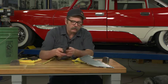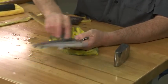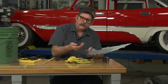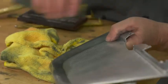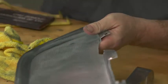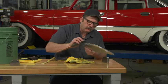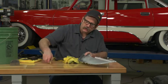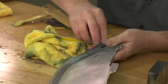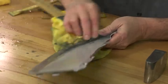Next we're going to move from 600 grit to 1200 grit. This will help refine the surface, make it a little easier to buff, and take out some of the sanding scratches left by the 600 grit. When you're taking the dings and dents out, if there's just a little high spot, when you start sanding it'll take off the high spots and even things out. Whereas if there are deep dings that are too low, there's pretty much no amount of sanding that's going to take those out — so you should go back in and use your hammer and dolly, or a nylon pry tool, to smooth out the rough spots. Aluminum will move really easy, so you don't need to use real aggressive tools to get it to shape and form.